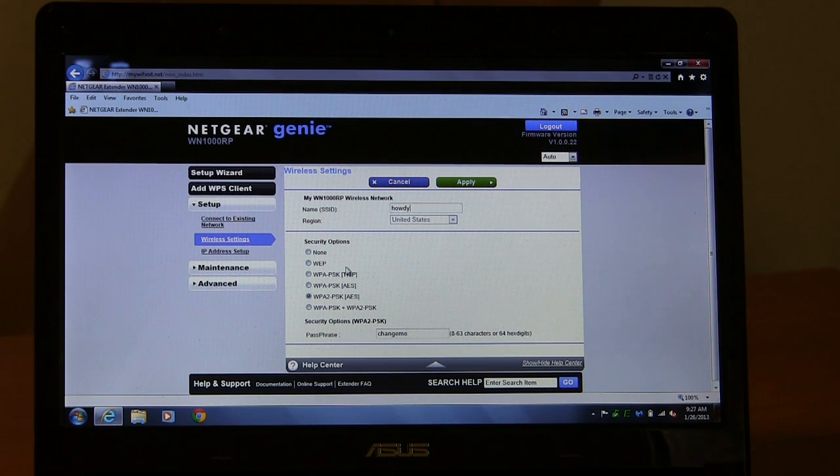Here are your security options. There seems to be an issue sometimes with connecting this to a router set for TKIP/AES — it prefers just plain AES. If you're having issues getting it to work, go into your router and change the security setting. Best of all, change the wireless mode to WPA2 with AES. That will resolve a lot of connection issues.